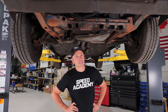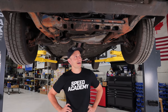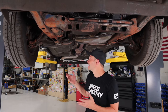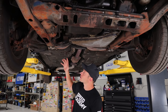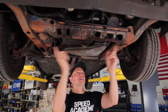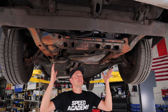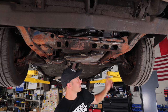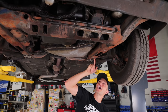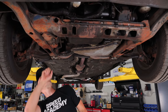Just so you guys know, this car has 154,000 kilometers on it — just under 100,000 miles — and underneath it has been severely coated with undercoating to protect it from rusting, which is a good thing. I can see the frame here, the cradle that holds the engine up — the subframe — has been replaced once. There's been fixes done here and the bushings are indeed shot in these lower control arms. Just looking at them, they look to be in pretty bad shape.